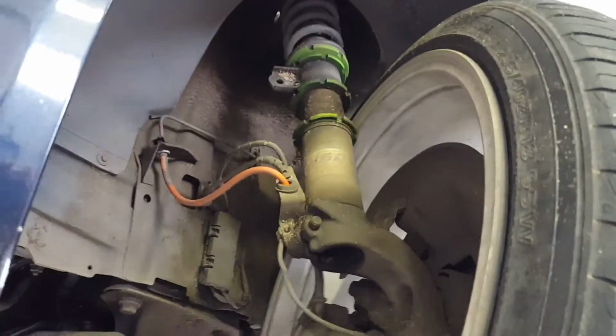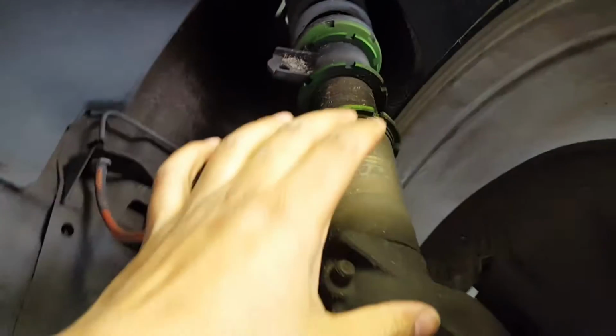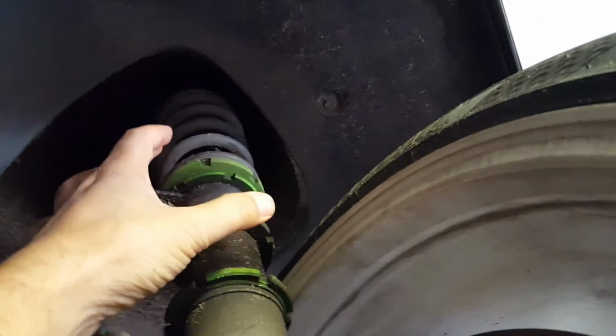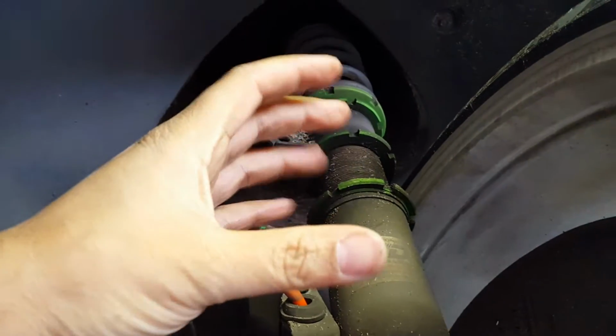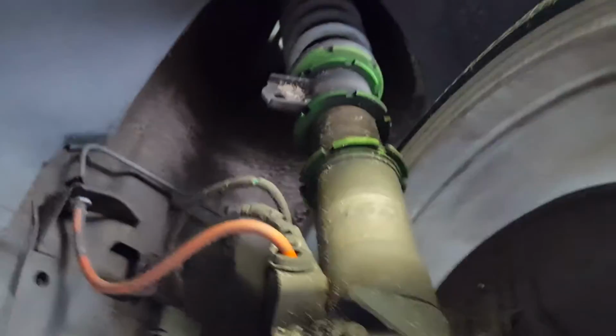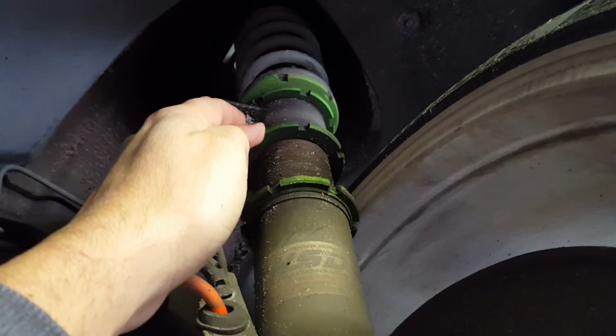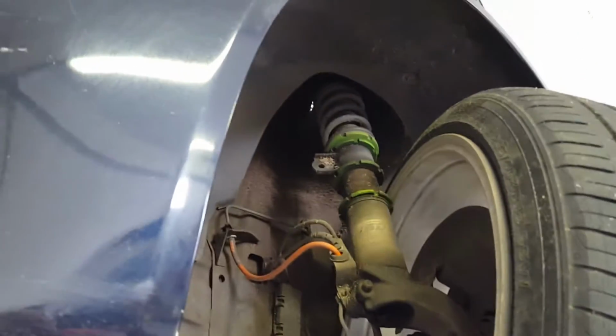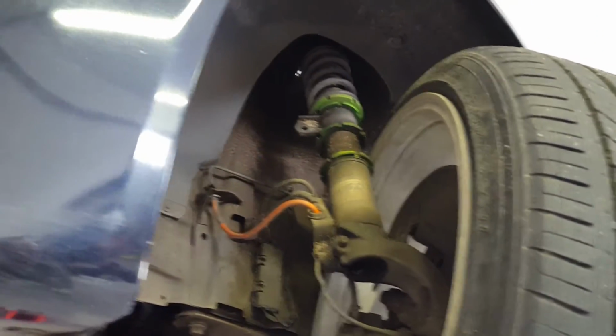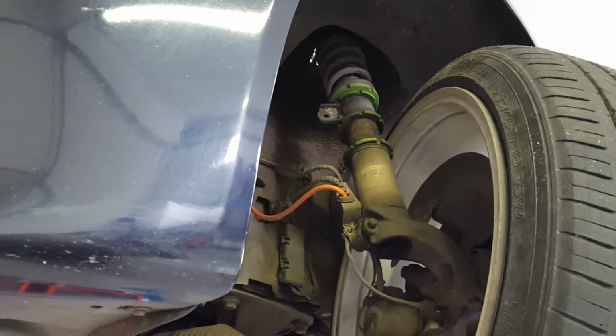Yeah, what's more? So when you put on your suspension, you will assemble your coilovers on the floor, on your bench or whatever. You'll just hand tighten these rings so that the spring up there is not loose, and then maybe turn this ring 180 degrees so it's tight. That's it. That's your settings. That's your preload. That's really good. At least that's what I think. And the same goes for the suspension in front.